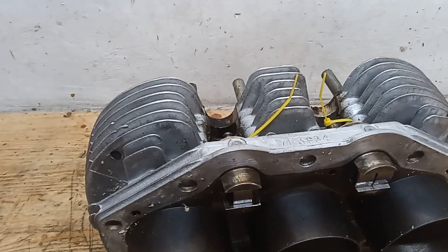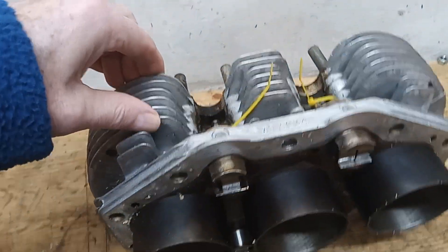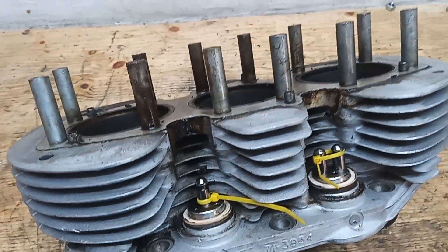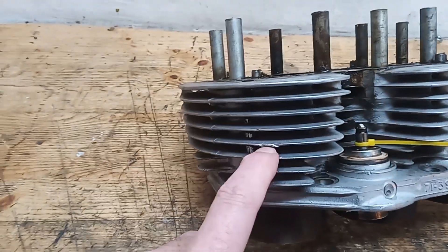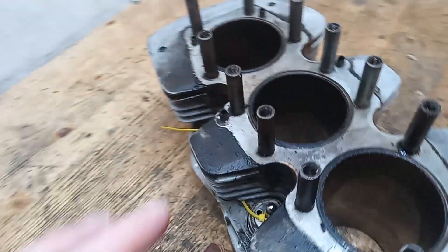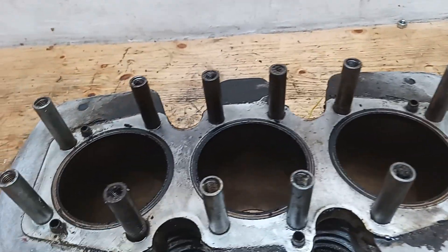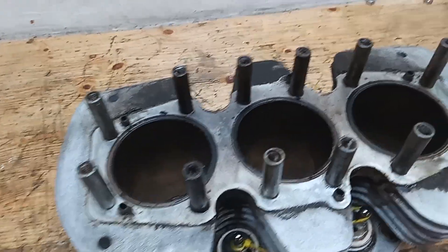I'll take them out and mark them so I know which cylinder they came from and which way around they go back in. Once we've taken the studs and tappets out, the barrels are ready to go down to be blast cleaned. We can see there's been an oil leak either from the head or somewhere above. There's a very slight knock on this fin I might try filing out, but be careful - if you file too much you lose the casting mark. The bores might get marked by the blasting but I'm not too worried because we're going to be reboring or at least re-honing the cylinders anyway.